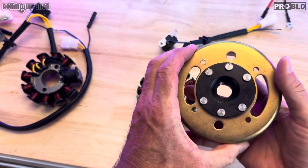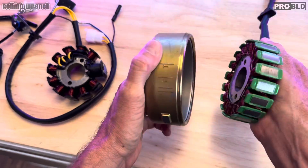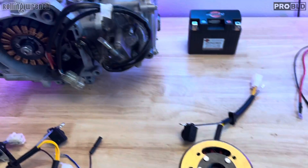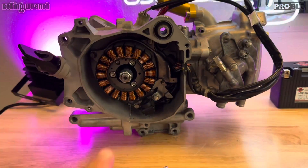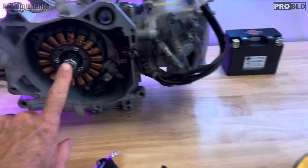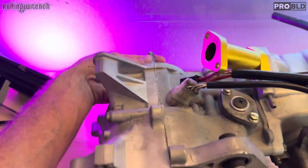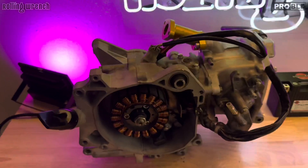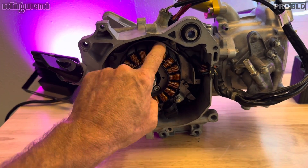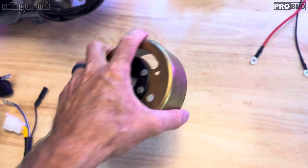Whenever you attach this to your engine — here's a scooter engine with an 18-pole stator — this engine has a magneto that goes on here. As the engine is spinning, you've got your crankshaft turning. As that's spinning, the magnets are going past these little charging coils, just like this — spinning, generating a charge. These three yellow wires are all getting a charge.